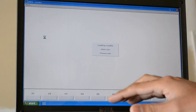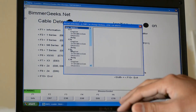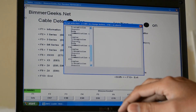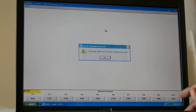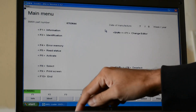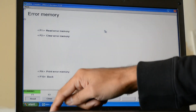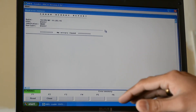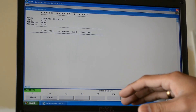Let's check if there are any error codes — shift F9, E39, ABS module, read error memory. No error memory. That clearly implies that the issue has been resolved. I will continue to monitor this long-term for about a year just to make sure I'm not getting any errors, and I'll keep you guys posted on that.